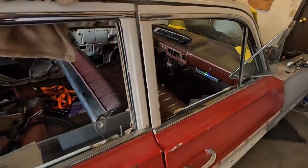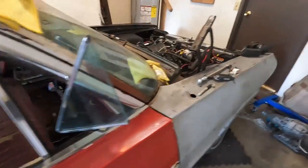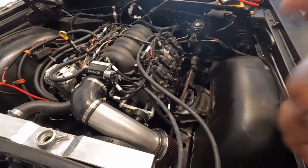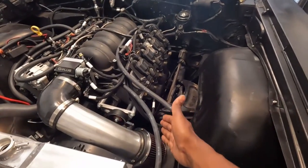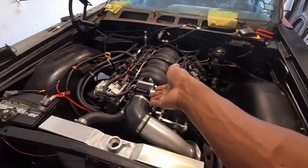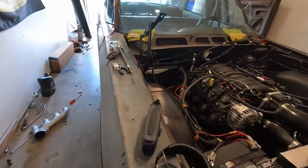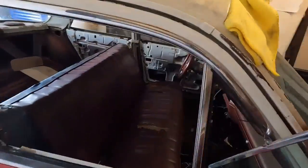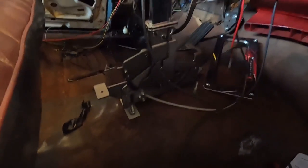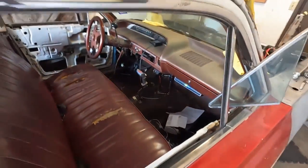A lot of people have just been curious about the whole setup — it wasn't too difficult to put together, just took a lot of research. Also, with these motor mounts, I've heard that if you use six-cylinder motor mounts the motor will sit a little taller. The transmission was so tall that I had to flip the actual mount bolts for the shifter around because they were hitting the top of the bell housing.